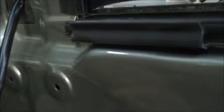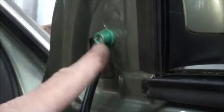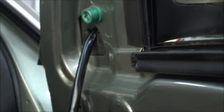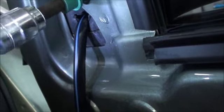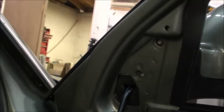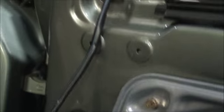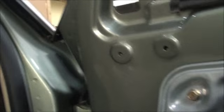We're ready to get this bolt out. What I did is loop the wire plug under itself to hold the mirror while working one-handed. If you have to pound on that bolt to get it loose, stop so you don't bust the aluminum cast center off the inside of the mirror. Bang on it gently with a hammer, spray some penetrating oil on it — that's basically all that holds the mirror.